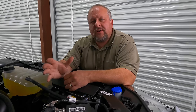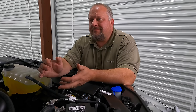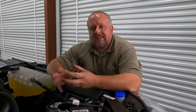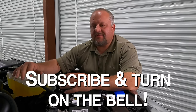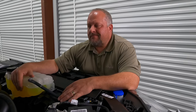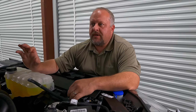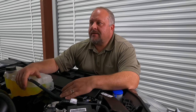The battery monitoring system that Ford put on these vehicles monitors things like rear defrost, heated and cooled seats, and fan controls when it's doing the auto start-stop. Since you're not going to have auto start-stop anymore, it doesn't need to monitor any of those things or tell the truck to kick back on. It's not really a big issue. The only thing I can see it being an issue is it won't be able to detect a faulty alternator ahead of time. There will be a plug-in module through FORScan that can be done in the future, but for right now this is free.